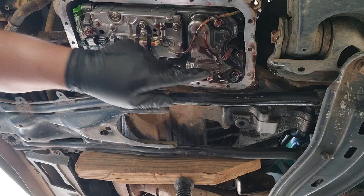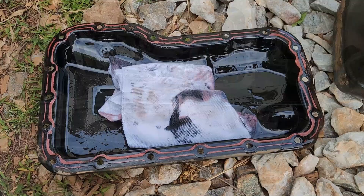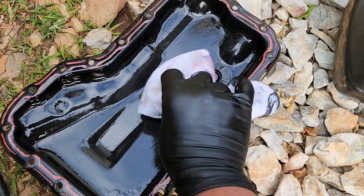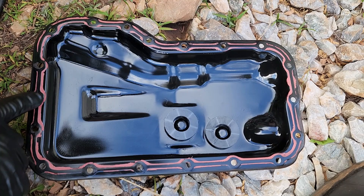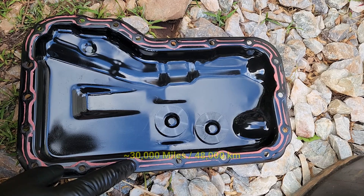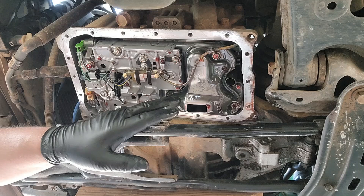This is where the dip tube goes in — the suction tube hooked up to the recovery container. I'm going to clean this pan now. I've got a rag here — just going to wipe everything up. I'll take these magnets out and wipe those down too. Got it all cleaned up. I left the RTV on from the first time I did this, and it didn't leak at all over however many thousands of miles, so I'm just going to leave it on and put the new gasket right over top of it. Now I'm going to get this transmission filter off.